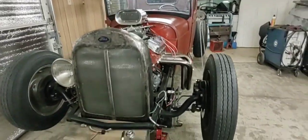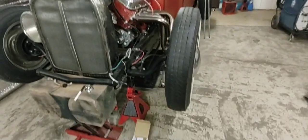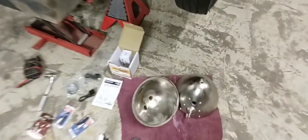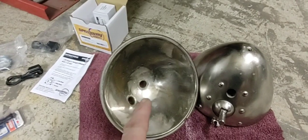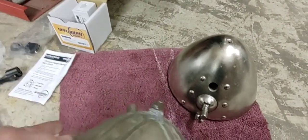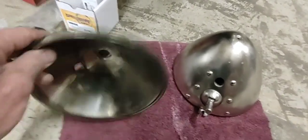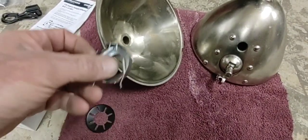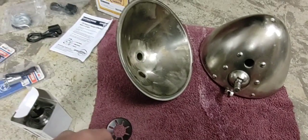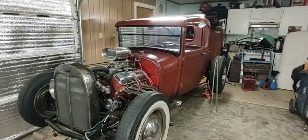She's kind of a one-eye wonder now. But I'm gonna get to drilling these headlights out. See if I can do it without ruining them. I might have to just cut that socket out of there with some tin snips. Then use my burr bit and make that an inch opening to slip these guys in here. So I'm gonna get on that. Try to get these headlights and blinkers working. Gotta have some headlights.